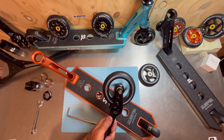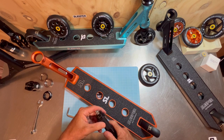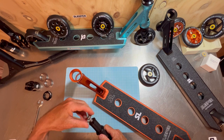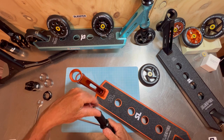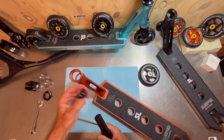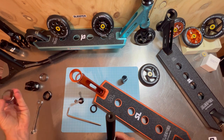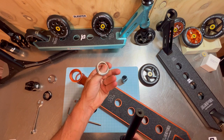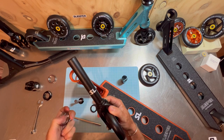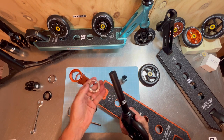Give the wheel a spin — beautiful and smooth. Next, we'll get the fork into the deck of the scooter. Unscrew the compression cap, take off the little bearing sleeve and the compression sleeve. Get one of your headset bearings — they're both exactly the same, nice closed design to keep all the crap out. On the fork you'll see a machined edge on the bottom which the bearing sits on, so slide it in — you'd call it upside down with the top of the bearing facing down.